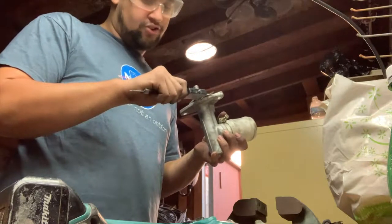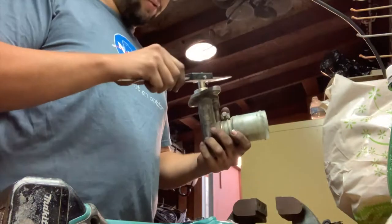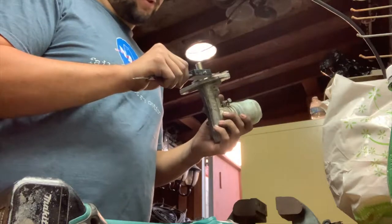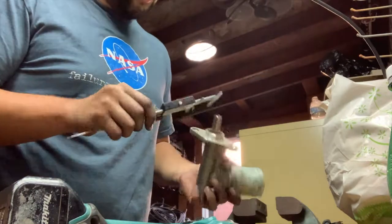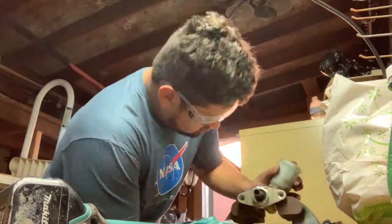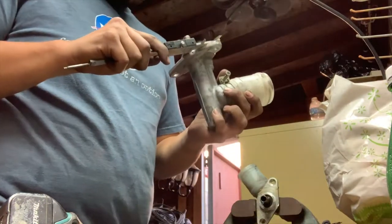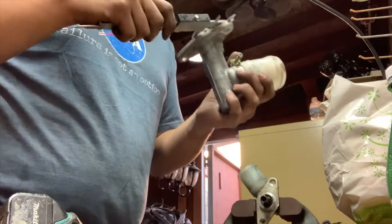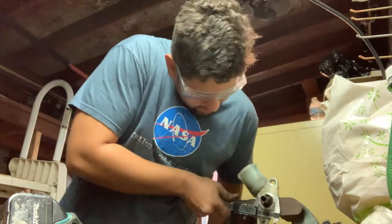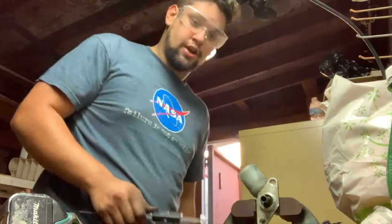This is 1.39 inches. I don't like using that. I'm gonna go to millimeters. All right, we got 35 millimeters. And on this one, right now, where I just cut, it's 39. So I really haven't cut these two portions, so I'm gonna go ahead and do that and kind of even out the thing, because it looks kind of ovalish right now. So we need at least 35. We got 39. Turning it around, it's obviously been perfect. 39, holy shit. I better get to cutting, boys.